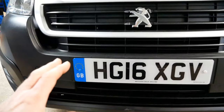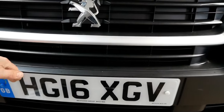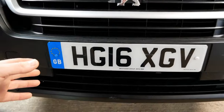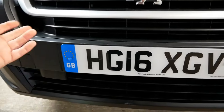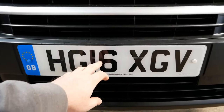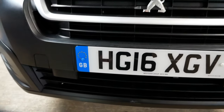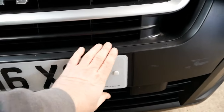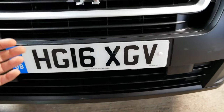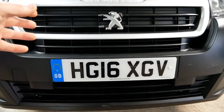However, there are times where you do need to fix it with screws, particularly when it's on the front of cars on a bumper. In this case we've got a plastic bumper with quite a curve, so there's a lot of force on that plate — it's better to put a screw either end. Sticky pads will hold it, but with a lot of curve I would often put one or two sticky pads on and a pair of screws, letting the screws take the force. A plastic bumper is also likely to get hit and flex, so screws hold the plate better. On this van we're going to screw the front plate on, but stick the back one on.